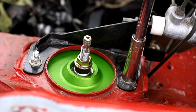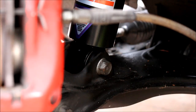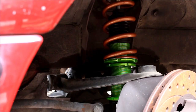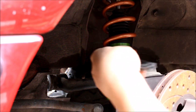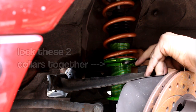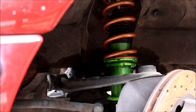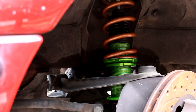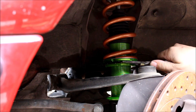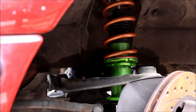These nuts don't have to be very tight at all — just snug so nothing comes loose. Now that everything's tightened down, I'm going to use the spanners that come with the coilovers to lock in the preload adjustment. I'll leave the bottom collar loose for now because after I put the car on the ground, I'll probably want to adjust the height again. To adjust ride height, make sure the bottom collar is loose, then use the spanners to spin the collars — it'll turn the whole shock. Unthread it to raise the car; thread it into the cup to lower the car.